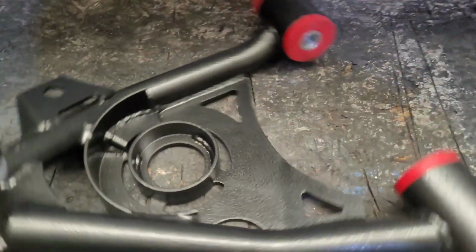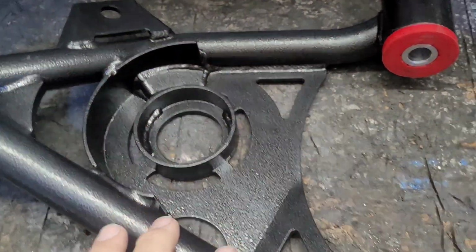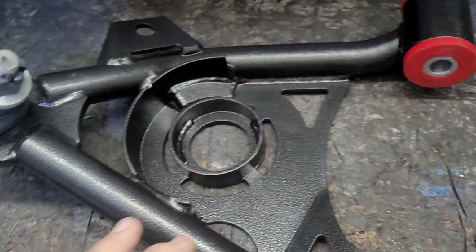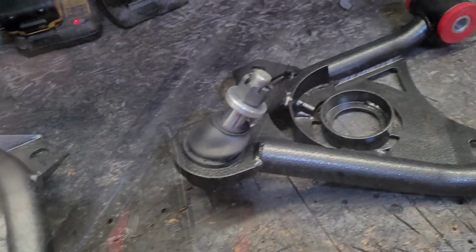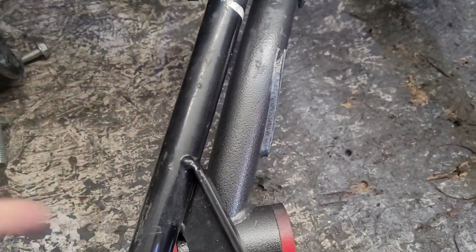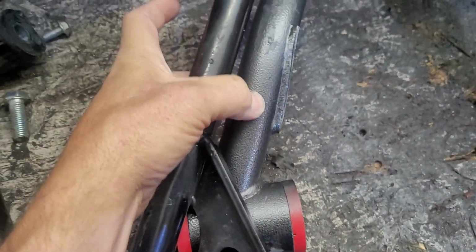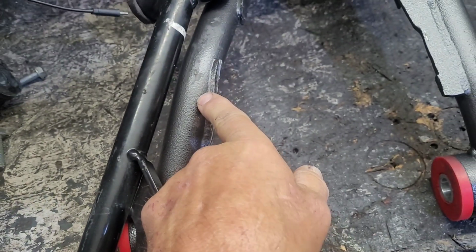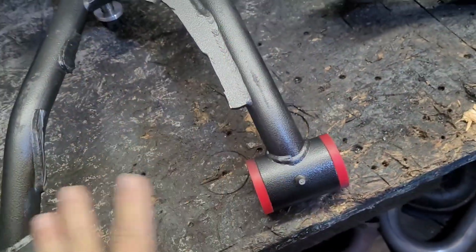Subject of weight. These are the two control arms. They have this here. This is a spring pocket. I don't have this. I have coilovers on the car, so I don't need it. So I got to cut all this crap out. See, I started cutting. And you say, Kevin, you can't do that, it's structural. Wait, I'll show you. That one didn't have the spring pocket. It's bent, they got in a wreck, but it didn't have the spring pocket. And you see, this one's even thicker metal. This is a BMR. This is an AJE. I'm with BMR. So cutting that out will not affect it at all, especially the way we use it. Yeah, straight line. So there we go.